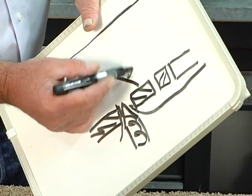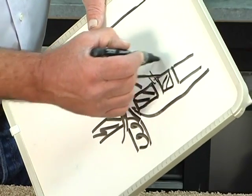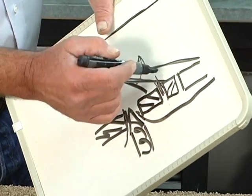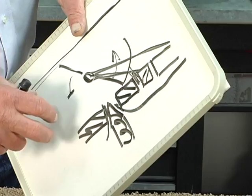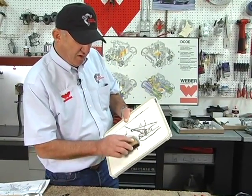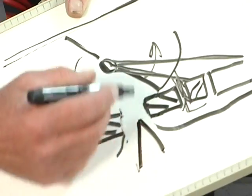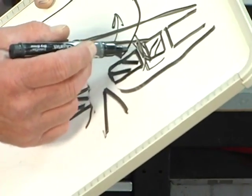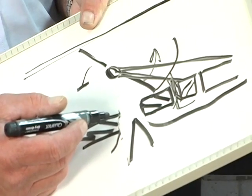As you step on the gas and the throttle blades move, they expose these holes. This blade's going to come up like this, and then eventually it's going to come up like that. And when they expose this hole, the throttle blade is obviously moving because it's swinging in an arc further away from the wall, allowing more air, which needs more fuel to balance. So it starts pulling fuel on this corner. The fuel has to turn this corner. If your mixture screw is outside of the window like that, the fuel flow through here is tremendous. So when the butterflies expose the progression hole, it won't turn the corner. Your progression will go lean because the mixture screw is so far out, and fuel is fluid and it takes the path of least resistance.